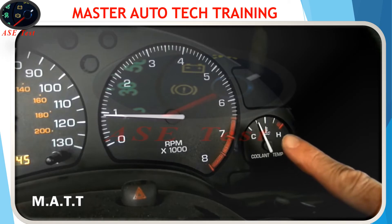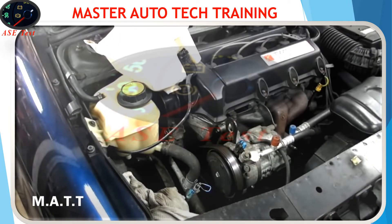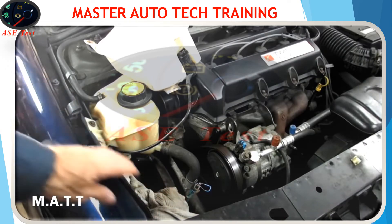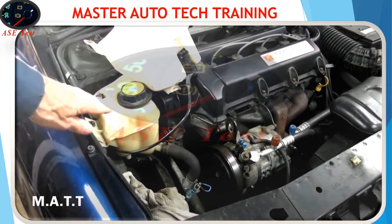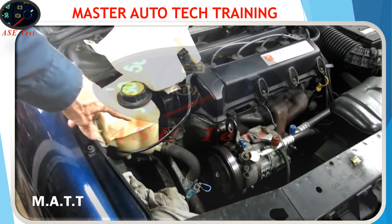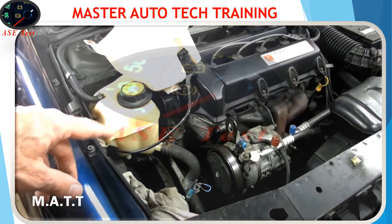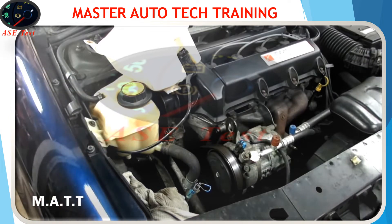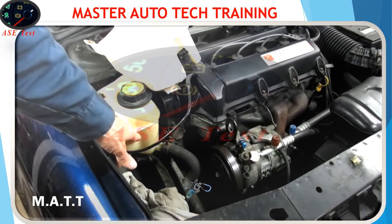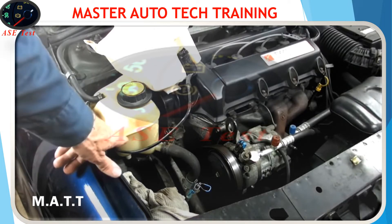So if you see that, that's the problem right there — there's something wrong with that sensor. So if the little jumper put the light out, well then the next step would be to take the tank off, make sure it's cold, and clean out the tank with some dishwashing liquid. Hopefully that float in there will unstick and then it will work. If not, well then you'll have to replace the whole unit.